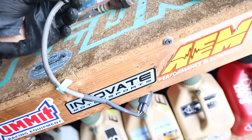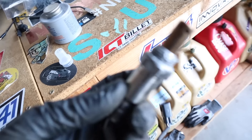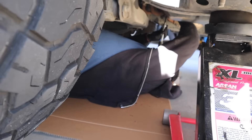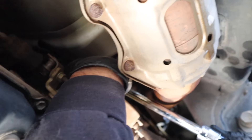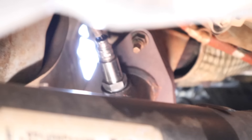Physically inspecting them — they look very similar; the old one looks round, the new one looks flat/straight, but it should be fine. Connectors are the same. Putting anti-seize on the threads so if it ever needs to be removed again it's not a pain. Go ahead and throw it back on. The passenger side is much harder to do — the other side was pretty easy. New O2 sensors installed right there.